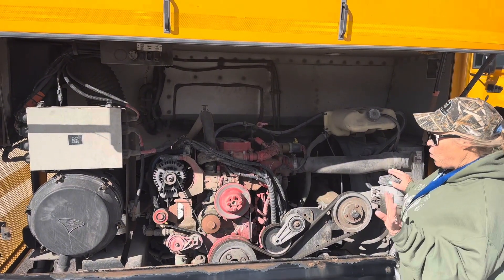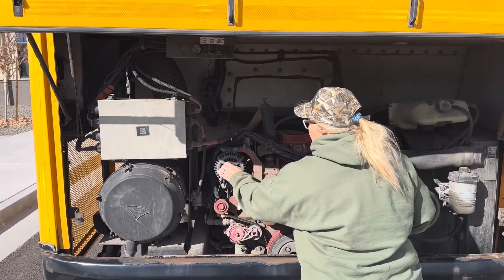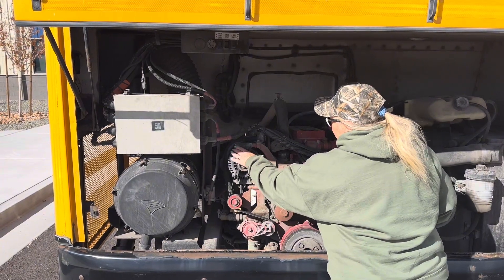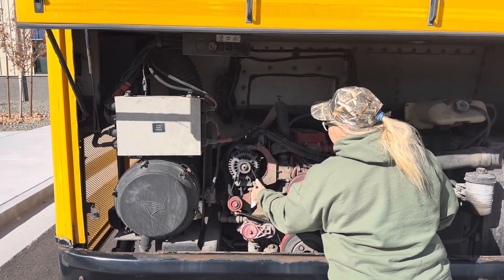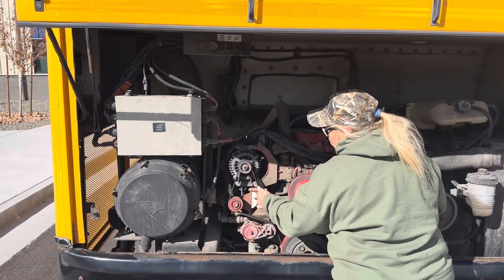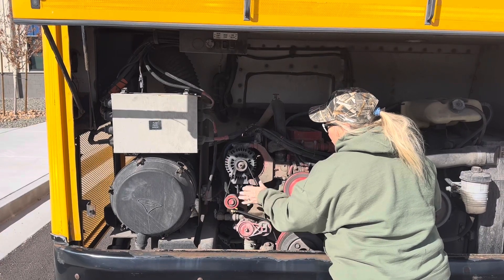After that, we're going to be doing four. We have four components. We've got an alternator. The alternator has copper wiring — none of that is exposed. It is securely mounted and it is belt driven. We're checking our belts for no more than half to three quarters of an inch of play. There are no shiny spots and no worn parts in this belt.